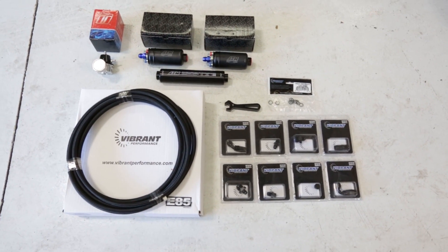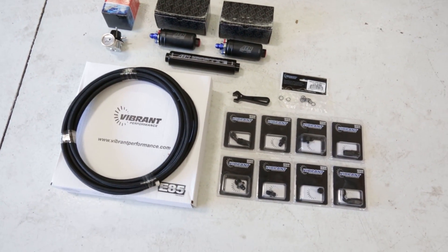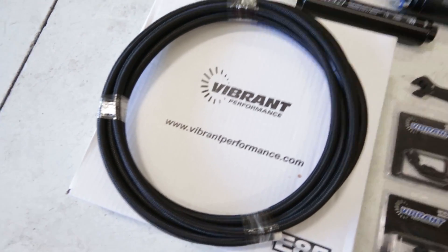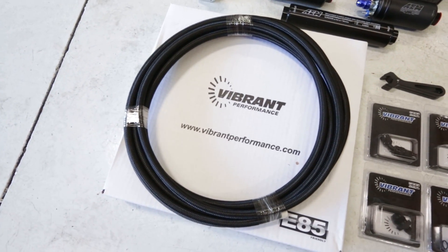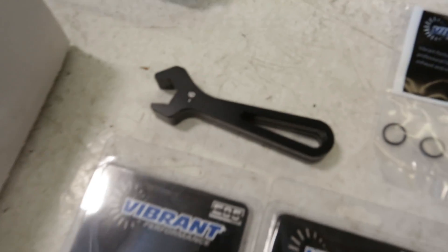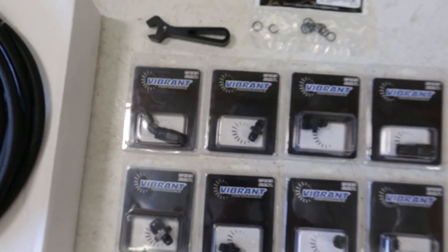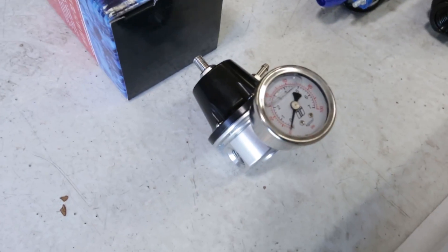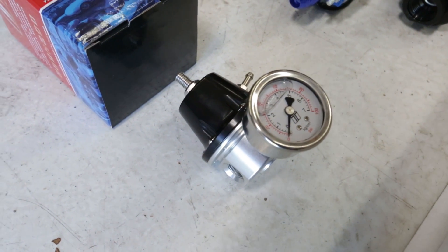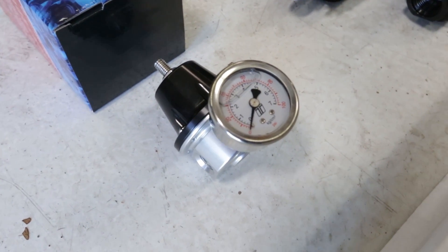As you've probably guessed, the Porsche's stock fuel system isn't going to be quite able to support the kind of horsepower I'm going to be making and the EFI setup. So once again, I've turned to Vibrant for all my fitting and hose needs. This is flexible race hose and we have a whole assortment of dash six fittings. Thank you guys over at Vibrant — we finally have some wrenches so we're not going to be scratching these fittings up. Moving on to our fuel pressure regulator, here is the Turbosmart FPR 1200, which supports up to 1200 horsepower. I'm not going to be hitting that much juice, but it's never a bad idea to be able to support more.